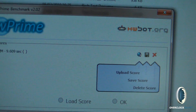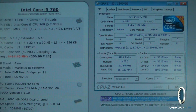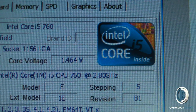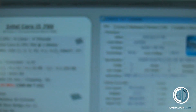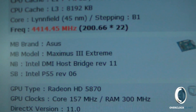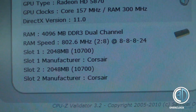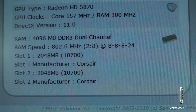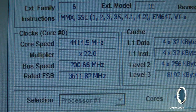The crucial one that everyone's going to want to know — I'll bring my screenshot up — is my maximum overclock. The max I managed to get out of the processor was 4.4 gigahertz. It did need ridiculous volts to get there but it was submitted and validated by CPU-Z on the Maximus 3 with the 5870. When I did that run I had the memory running at slightly less — just 1600 megahertz — because at 2000 it wouldn't run. It was 4.4 gigahertz, 200 bus, and the 22 multiplier which is the top end.